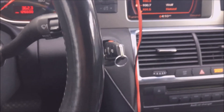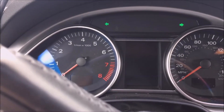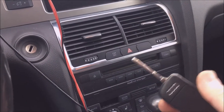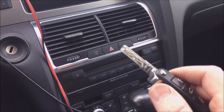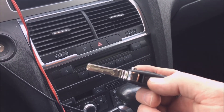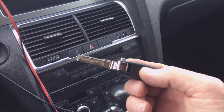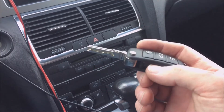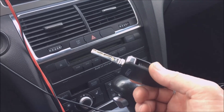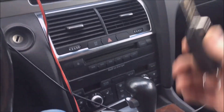That's how we make a spare flat key and program it into a Q7. Just a heads up — this is a factory key. The remote will work, but if you buy an aftermarket one, I've tried about 25 or 30 of them and have yet to have one actually work. The 8E chip in these is on board — same thing with the A6 — and it programs the remote the same as it does the chip that starts the car. Aftermarket ones tried from China and US resellers that have been supposedly unlocked — never had one that worked. The Touareg key is pretty similar except it has a 46 chip, not an 8E chip. Good luck, we'll see you on the next one.